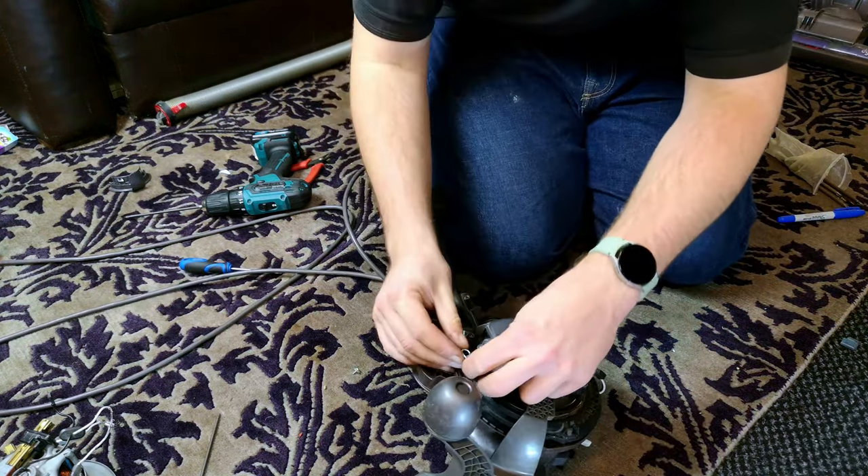Start from the top here: put your rubber bung in, put the loop of cable down, back up, and then sit that plastic piece there. Run the wires down, flip them around, and run them right down the back to the bottom. When they're all in their channels it's very fiddly; the socket sits flush like so. You'll notice this has a chip missing out of it - that means this machine will have a lean. If you need to replace your recline latch bracket, do it now. Then holding that down, get it as low as you can and slide the slider into place.